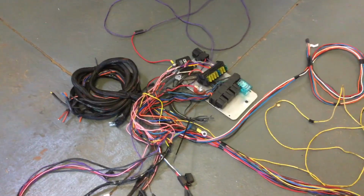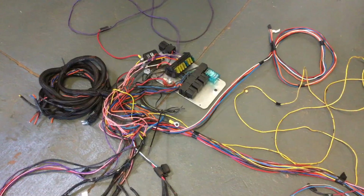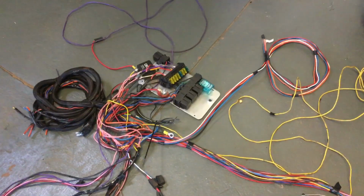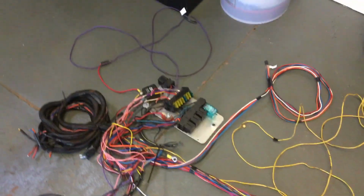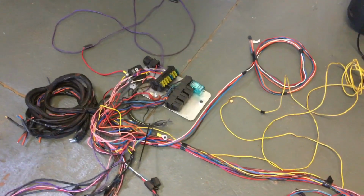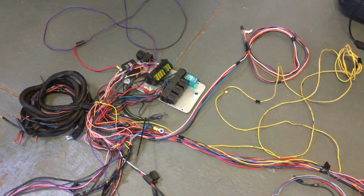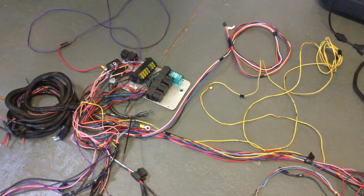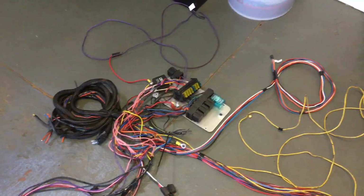So this had a detrimental effect to basically how everything ran in the car. Last time I drove the car at night time, the headlights had dulled, brand new headlights, and they dulled like a brownout. On further investigation, I found that one wasn't ground to its factory spot, wasn't bare metal. The other one wasn't bare metal, so I bare metaled them.